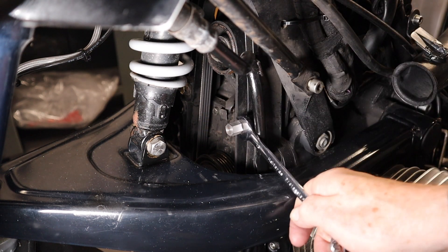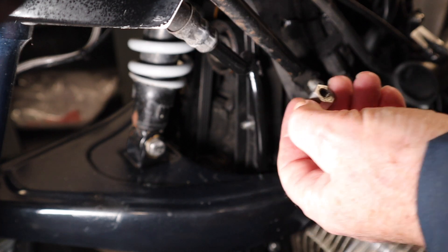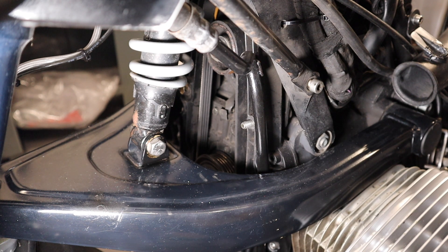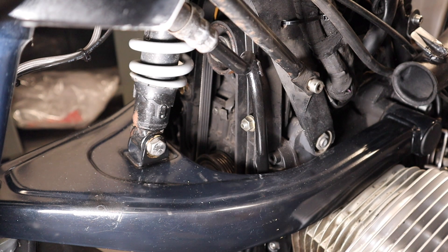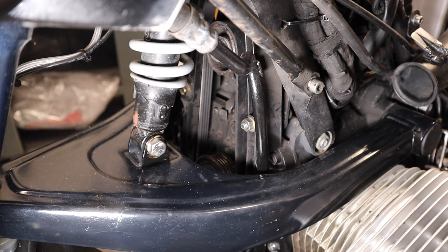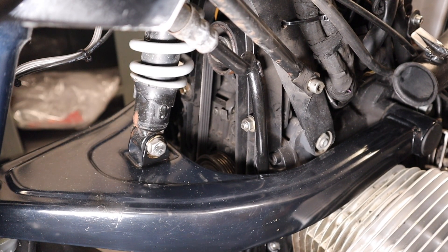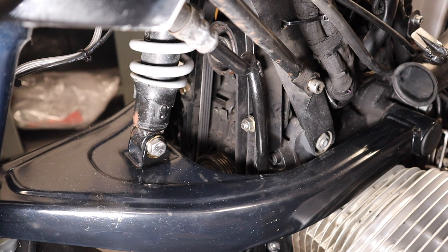You don't need to take your tank off — I don't think so, I don't know why you would have to. It's a little tool I'm going to put in my special BMW drawer to be used probably once a year. Now the original bolt, nut, and washer go back on there, and I've got to tighten them up to the correct torque — it is 20 Newton meters for the bolts. You can do the two: one there, one there. The top one you just need to do as tight as you can because you can't get a torque wrench up. What a better way of adjusting your alternator belt to exactly eight Newton meters — it wouldn't be a problem to take it off at any time and just check it.